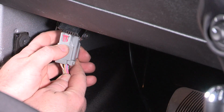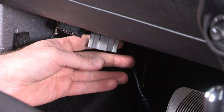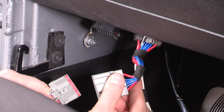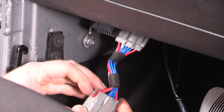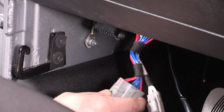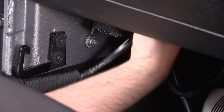Moving to the interior of the Jeep, reach up under the dash and unplug the driver door electrical harness connector. Locate one of the 2 T-harnesses and install it, plugging it in between the door harness you just disconnected. Then plug the connector coming from the driver's side mirror into the 3rd connection on the T-harness. Attach the new T-harness Christmas tree connectors into the factory mounting holes.